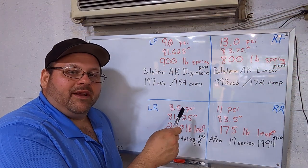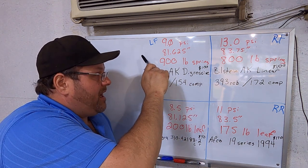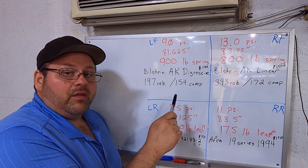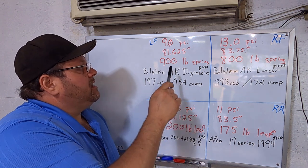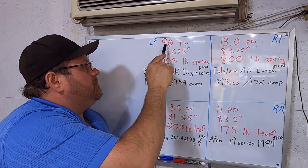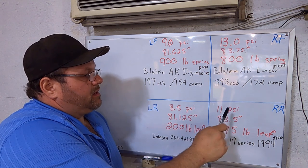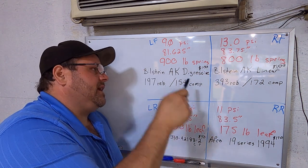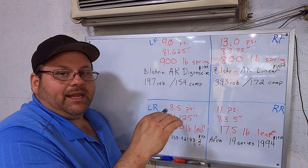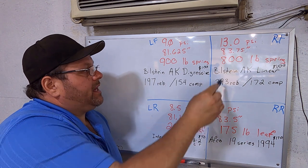Here's where the money's at — this is my Camaro setup board. I've got my air pressure set, all my stagger and rollout on my tires measured, and additional information on what's currently on the car. These are asphalt pull-offs. Air pressures: 9 pounds left front, 8.5 pounds left rear, 13 pounds right front, 11 pounds right rear. This is a setup for a smooth, dry slick, medium bank — not a real aggressive bowl banking.